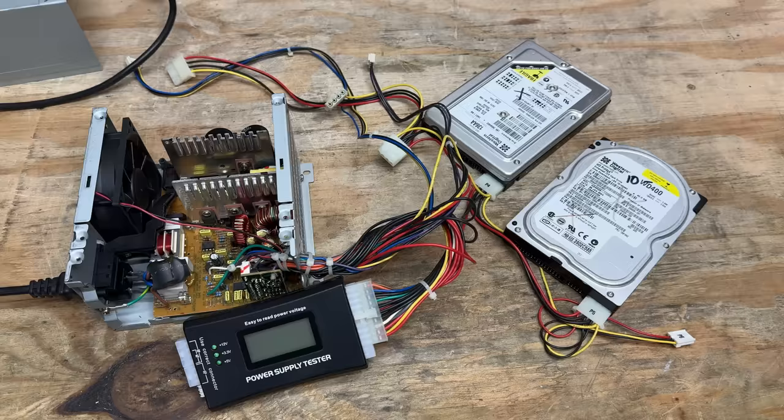Let's continue. It looks like some kind of NT - yep, Windows XP. Now this thing is dragging slow. I think that hard drive's probably not very healthy. Let's see if we even make it through this boot process. Finally, after about 20 minutes, let's see how long logging in takes. This slowness is not the fault of the hard drive - that thing sounds fine, something else is going on here. This type of issue can only be explained by memory weirdness. So I'm going to replace the mismatched pair with a single 256-meg PC100 stick and see how that goes.